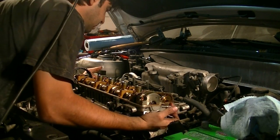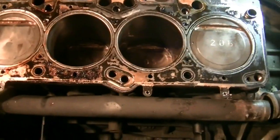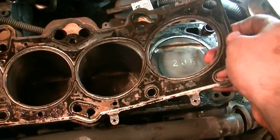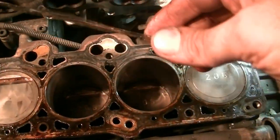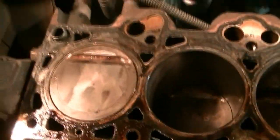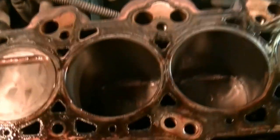Here's a look at our block and cylinder head gasket. Let's see if we can pry this off — yep, it's still intact. It's a multi-layered head gasket, still intact, but it doesn't really matter once your cylinder head warps beyond a certain amount. Air just escapes right between the cylinder bores.